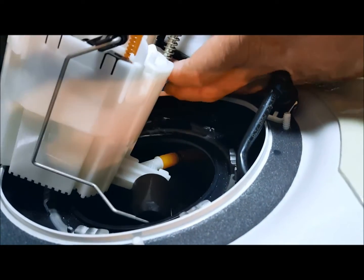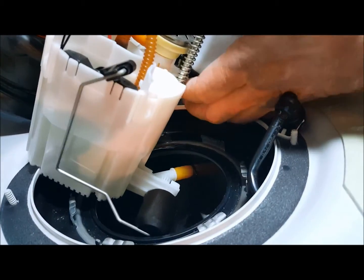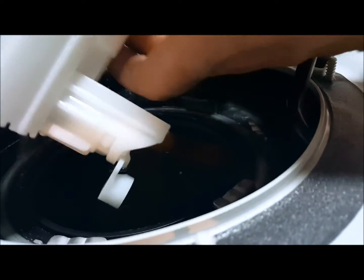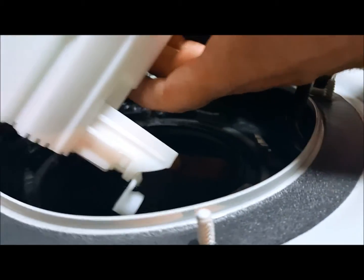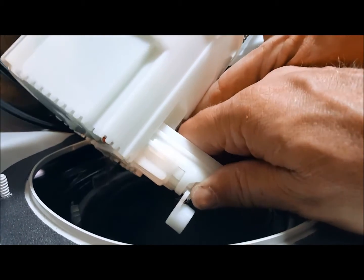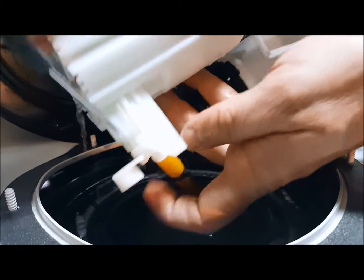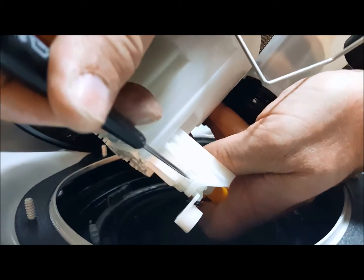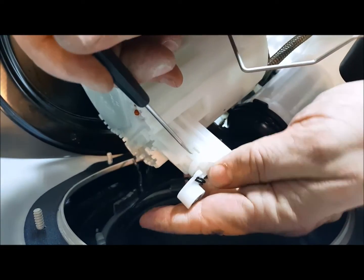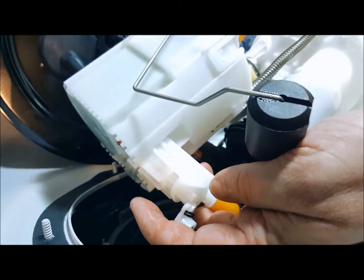Now you can see what I was talking about. There's the driver's side Venturi line where we have rotated it 90 degrees — the stock position is for it to be straight up. If we pull this float assembly up out of the way, you can see on the bottom side there's a little quick release right here. We have to slide this forward and then depress this little catch lever here. I can manage both at the same time here.